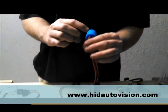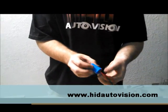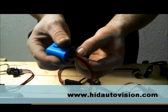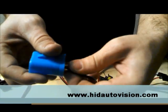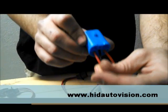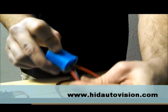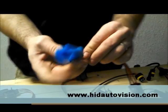Once you're having that issue, you want to swap those wires around. Instead of red, black, red — it's red, red, black. So you just got to move these two end wires. The way you can tell is where this clip is. You want to take these two here on the left hand side and swap them around. I was looking at it upside down, that's why I almost made the mistake. So be careful and make sure you're looking at that clip at the top that locks it in. Those two on the left hand side are the ones you want to swap around.